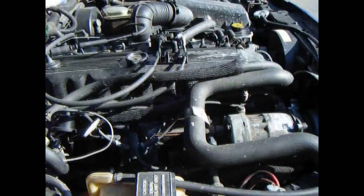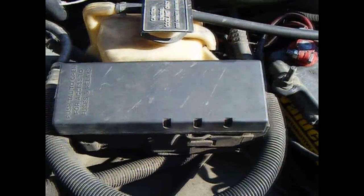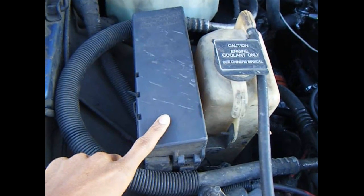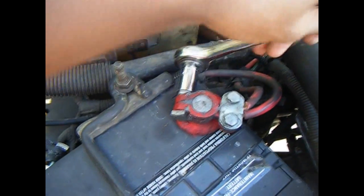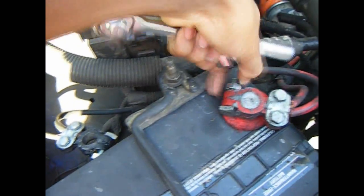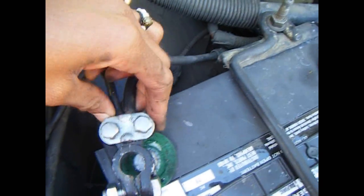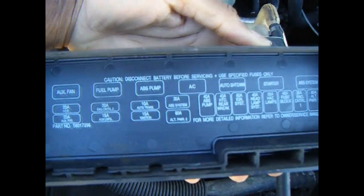— the service manual, and I was able to solve this problem. Most cars have two fuse boxes: one under the hood, sometimes near the battery, and one under or behind the dashboard. Now, before I do anything electrical, I disconnect the battery cables. I think you only have to disconnect one cable, but I do both.